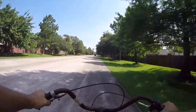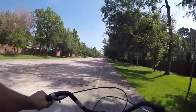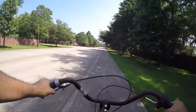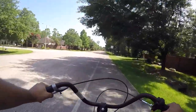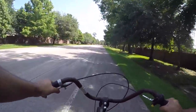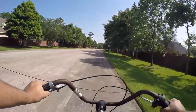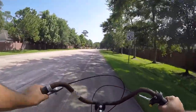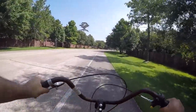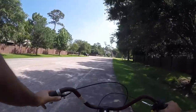Okay, it's making noises. That is not good. Still looks good. Basically, all I did was tighten that chain. Well, I put some spacers under the motor, like just washers. It raised the motor up a little bit, which tightened the chain. I hope y'all can hear me. But that pretty much made the chain tight. It doesn't slip anymore. That's the main problem I was running into. I guess those popping noises are still that chain hitting the frame or my makeshift motor mount. Yeah, I guess that's what it is.